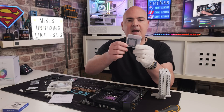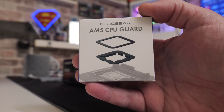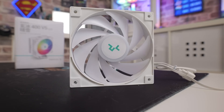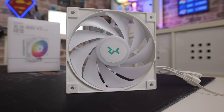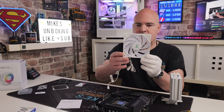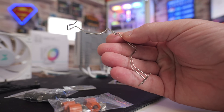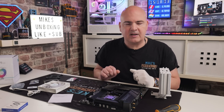Optionally, you can use an AM5 paste guard to stop the paste going down inside your socket. These are optional but well worth doing, especially if you're going to be swapping coolers or processors in and out — it keeps things a little bit cleaner. You'll also need the 120mm fan, either ARGB or standard depending on which you've got in your kit. These are available in both black and white, and non-RGB and ARGB. You'll also need the two securing clips to attach the fan to the cooler. Now let's go to the motherboard and start the installation.